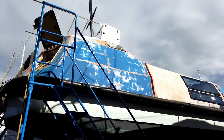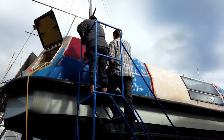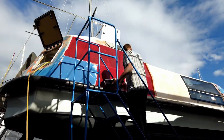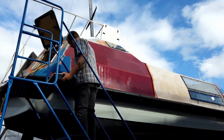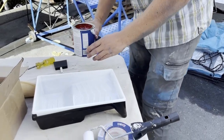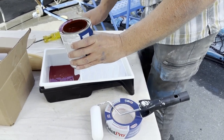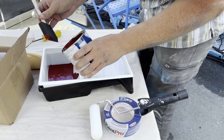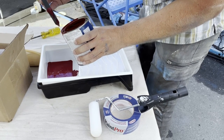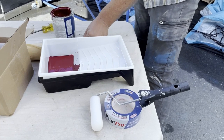You'll see in a second, we're kind of rolling and tipping here. We tried a few different things. Rolling and tipping is where the first person rolls it on, and then the next person takes a dampened paint brush and extends the wet edge so that it doesn't dry — you can blend the whole area in together. We ended up finding that it didn't really help us all that much, so we just moved on to one person painting and keeping it going as fast as possible. We found that it worked better for one person to do it at a time. Lots of people have had a lot of success with rolling and tipping. We got a ten-foot paint job that we're pretty happy with.